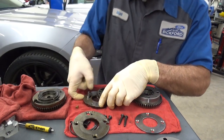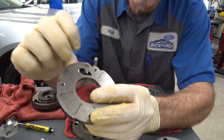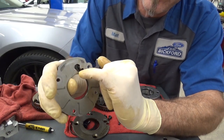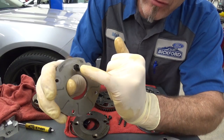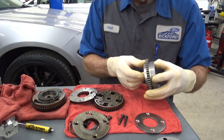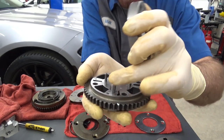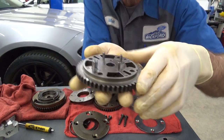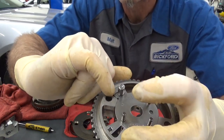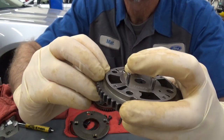And this one — so this original version definitely has a flaw. I don't know if it's the material or the way that the oil goes to evacuate out of it, and if it's hydro-locking, the pin can't fully engage in the slot. But they've done a drastic difference in this one and I suspect this will solve the issue. It looks like there may be a drain-back slot — like a channel right there, right in there.